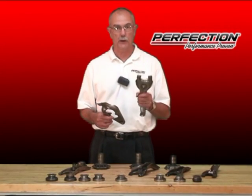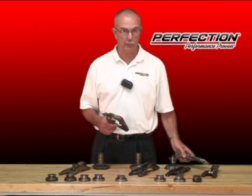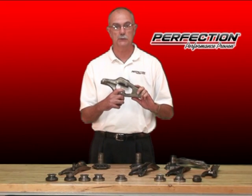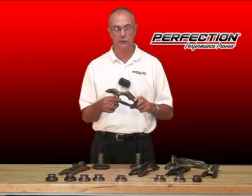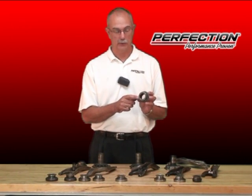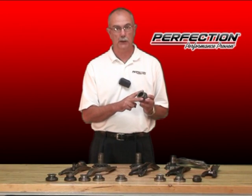Now you've seen the correct way to install that bearing on the fork and just how critical that relationship is — we have to do it right every time. This one's for an S10; you can see a different style fork, but the same relationship and the same potential to make a mistake — the spring tabs on the back side. And if you thought GM was the only place this could happen, this bearing belongs to a Ford Mustang. You can put it wrong on that fork also; we don't see it as commonly, but it can be done.